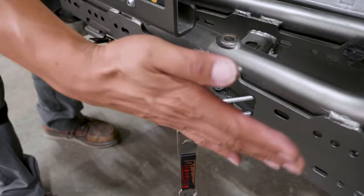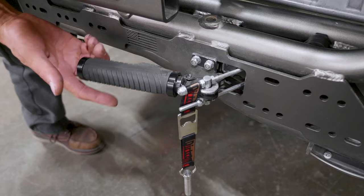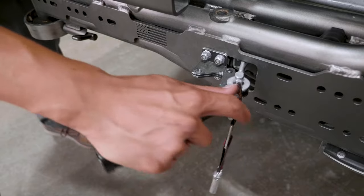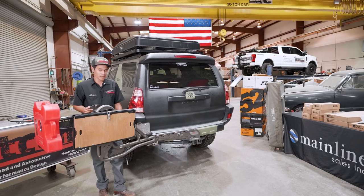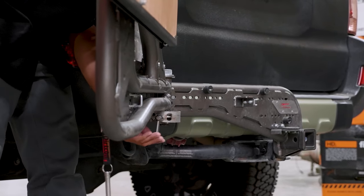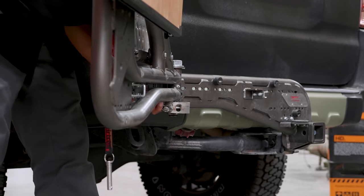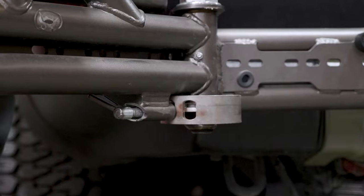When you go to close this, you want to make sure the latch is open in that position. Swing it back and this lanyard will actually help push that U-bolt into the latch — see how it just locked. If it's not latching, that's fine too; sometimes you might need to help it with your thumb. One other tip: this auto latch — when it latches in on some points it'll be really tight. If you find the middle of it you'll see it's loose. It's on a cam system, so if you just pull it up with your finger, it's in the free swing position.